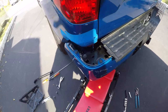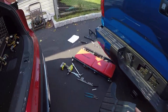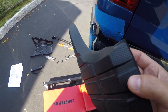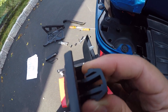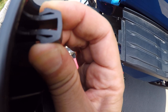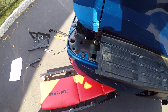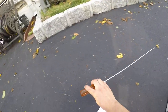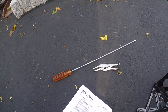One of the hard parts was lifting up this bumper cover. One of the first steps you have to do is take this front corner piece — the rear corner piece — off. They're held in with these plastic clips that go into square holes in the bumper, and you basically have to squeeze them so you don't break them. The hard part is getting access to them from underneath.